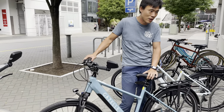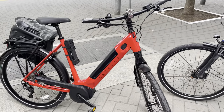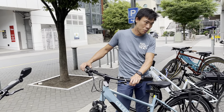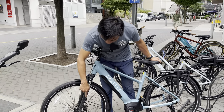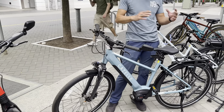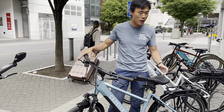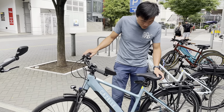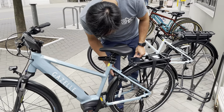Gentle braking is nice — anticipate your braking distance and never try to do it last minute. Give as much distance as possible; that's very important for safety. When you brake, apply even pressure left and right, front and back. Your bike is thoughtfully designed with different rotor sizes — 180mm in the front and 160mm in the back — slightly bigger in front to apply the ultimate distribution of braking power front and back. Just do it evenly; you don't need to emphasize any single brake.